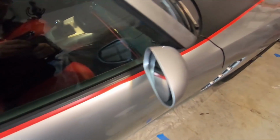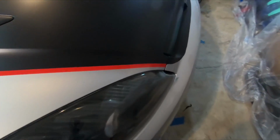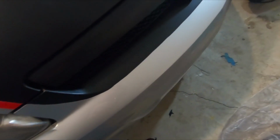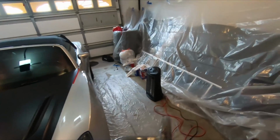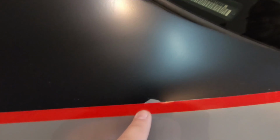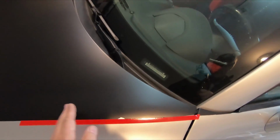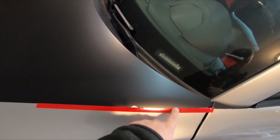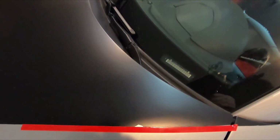and then eventually I'm going to be going off to the back. I think this looks pretty good. I have it finished right here, and I still have to do around this side, but I'm going to wait until I get that one section fixed up here. You can see I blocked it off a little bit. It's this stupid little thing right there. So when I'm ready to paint, I'm just going to block off this area and then spray a bunch of quick coats just on this little area, so that it blends in with the rest of the hood.